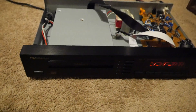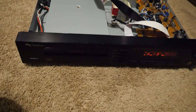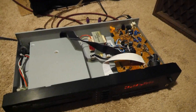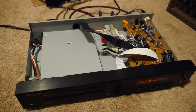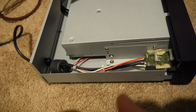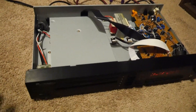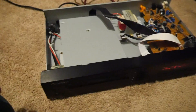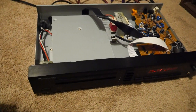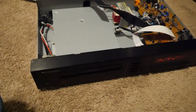It's basically a 5-disc changer and it uses a slot instead of a drawer. Nakamichi's engineers were able to get a 5-disc changer into a space this small. They basically used this same mechanism in a computer server as well — you could buy these drives to put in computer servers. Now you can't just buy one off the shelf if yours is broken because there's a different circuit board inside, but it's the same basic form factor.